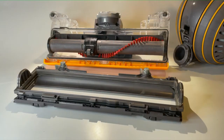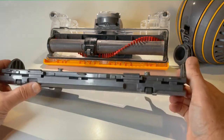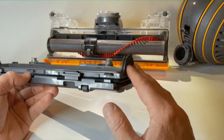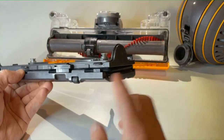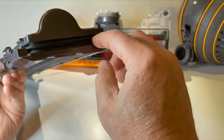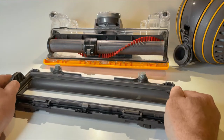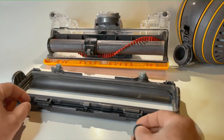Okay, let's take a look at how I solved the problem with moving on carpet. So I took the cleaner head off of the vacuum. I removed the sole plate from the vacuum. And the sole plate has three main components: there's an upper plastic piece that connects to the cleaner head, a bottom plastic piece that goes on the surface of the floor, and then a black rubber membrane that goes around and creates that vacuum seal. So when it's on the carpet, it just bogs down and it doesn't allow air to flow in.